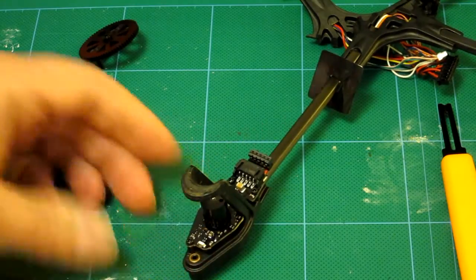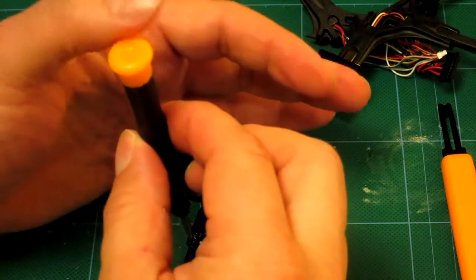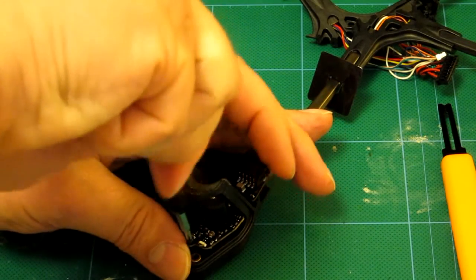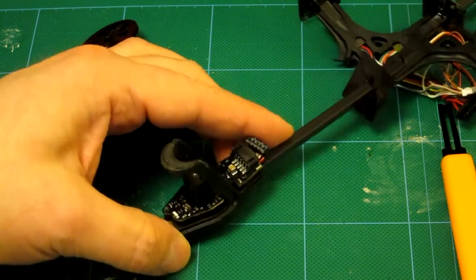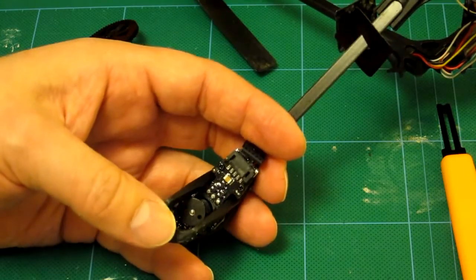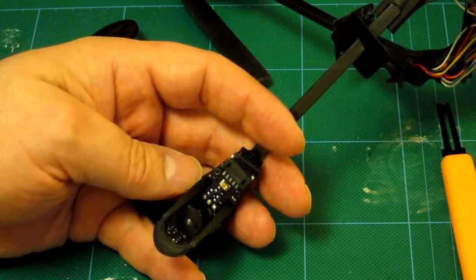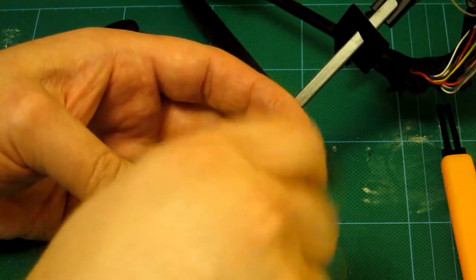I'm now going to focus on actually removing the motor and the board from this particular foot. There are three screws — I'm using the tool again. It's a little bit wobbly so you really need to brace the unit as you're doing this and try to come in at an angle so you can still see what you're doing. I'd always recommend a good board to keep track of small screws. You get a feel for how tight these are screwed in, which is important for when you reattach this into your new unit.